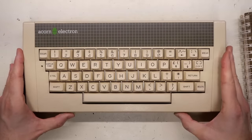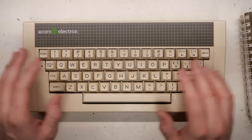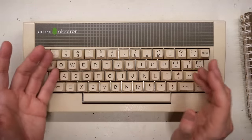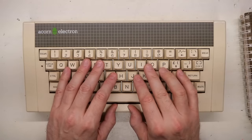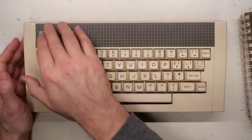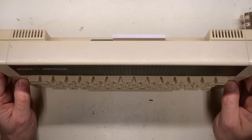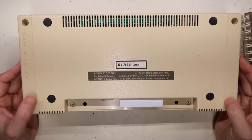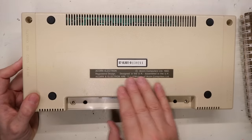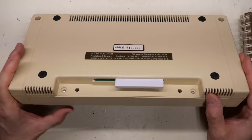The Electron has no BBC branding and is physically much smaller, designed specifically for the home user, yet retains some compatibility with other BBC models including the same BBC Basic. Like its siblings, it's a 6502-based computer, but with a very simplified motherboard lacking many expansion capabilities, which helped reduce cost. The form factor is absolutely adorable. The keyboard feels really nice to type on — I think these are very similar or the same mechanical switches as on the BBC Master. On the bottom it says Acorn 1982, making this a PAL computer from the UK. On the side is a 19-volt AC input.